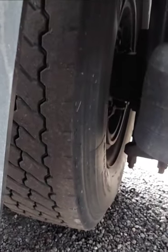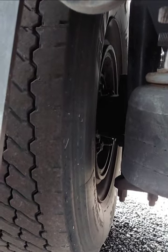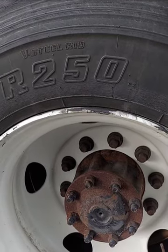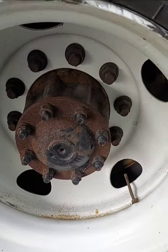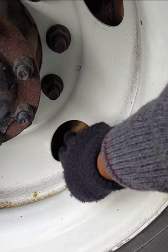I got my tires. I will start with my brake drum — two brake drums for my two tires — secure, no crack or illegal wear. My brake shoes, no debris, lining at least one quarter inch thick. My mud flap, no more than six inches from the ground. My shock — this is my shock right here — secure, no dent, crack or leaking. My wheels, in and outside of both wheels, secure, no crack or illegal wear. My lug nuts, secure, no missing, no sign of being loose, indicated by bleeding rust or shiny metal. Hub seal and axle seal — in and outside, secure, no leaking. Two valve stems — two metal valve stems with two metal caps.